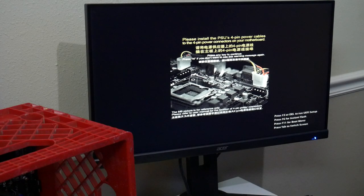For this particular build, the above 4G decoding setting will already be set by default. Since we're only doing four GPUs, we don't need both Molexes plugged in. Because of the design of the motherboard, one of the Molexes would face into the milk crate anyway. Since we can only fit four GPUs on the milk crate, we won't need more than one supplemental Molex power adapter. When you boot up it will give you an error — hit N to not see the error again, and it'll reboot and skip that notification about the missing Molex.